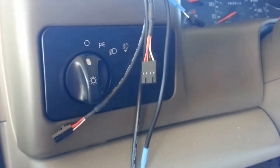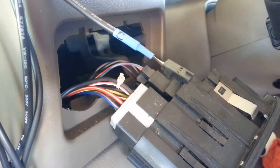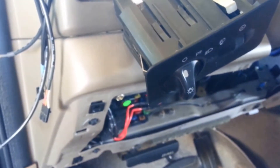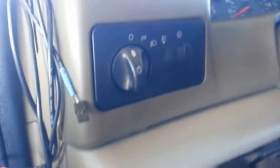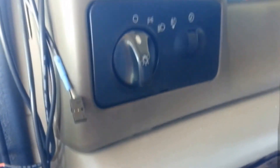I picked up the switched source behind here — I might pop that off to show you. For the parking lights on this 2001 F-250, you'll notice that wire right there which is a red with white. I soldered those two connections together so the gauges will dim when you turn on your headlights. I've tested it and that is working. It just snaps out — you stick a screwdriver under that little slot, pop it out, and you can get to the back of that.